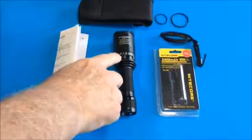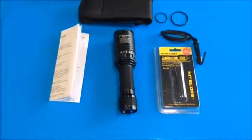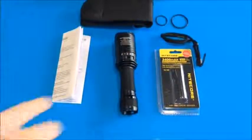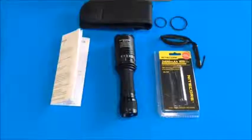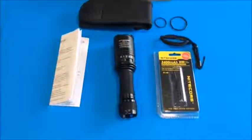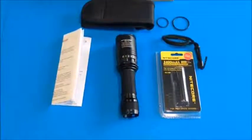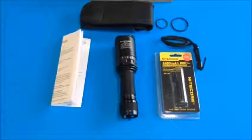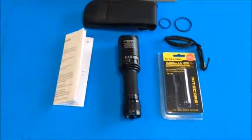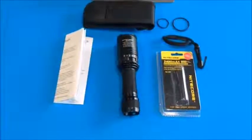The flashlight, as you see here, has a switch to adjust the lighting modes. It has 3 modes. First of all, it can be off, and then when it's on number 3, which is the brightest level, it can output 830 lumens for 1 hour and 45 minutes. On the number 2 setting, 320 lumens for 3 hours, and when it's on the first setting, 4 lumens for 150 hours. The flashlight itself is temperature protected to prevent overheating and damage to the flashlight.